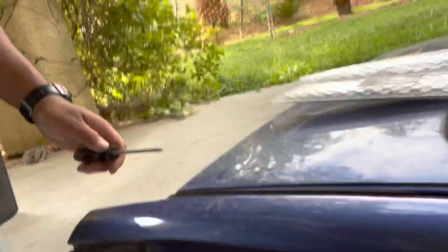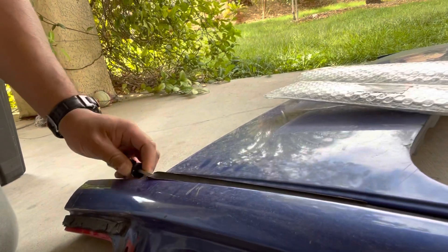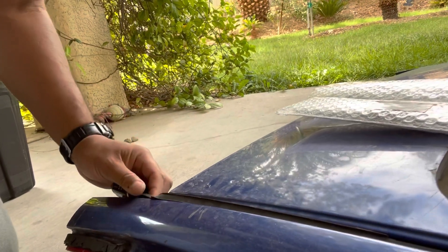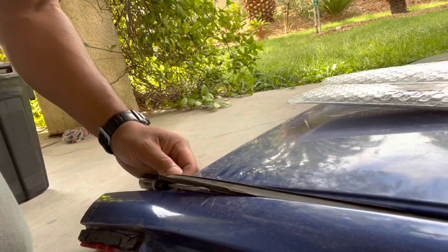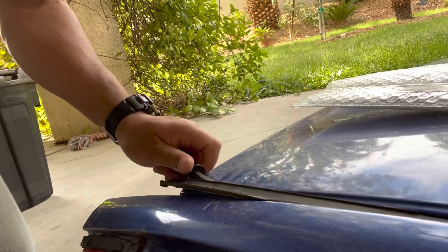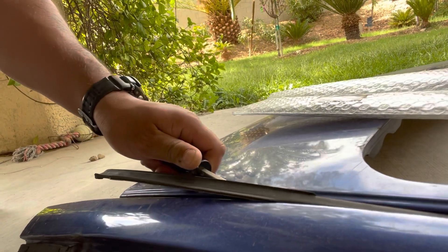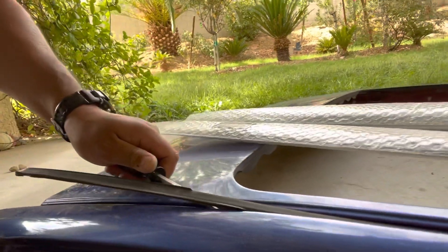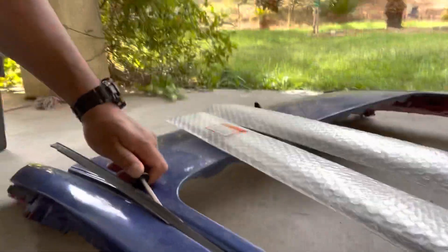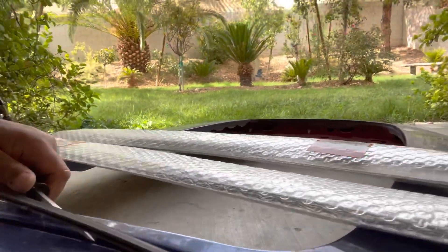What I did is start near the rear here and then just pry up with a flathead screwdriver. What you're going to do is pop the rear clip. Then you want to make sure that you go slow and steady and you don't bend the molding too much, otherwise it's going to get kind of warped. If you're trying to save this one for future use, you obviously don't want to bend it.